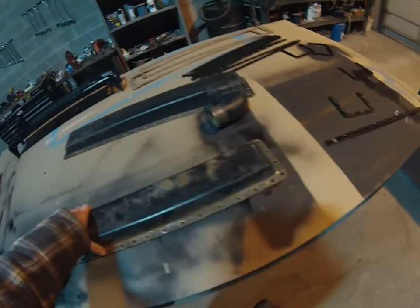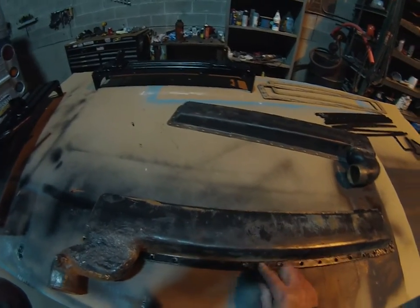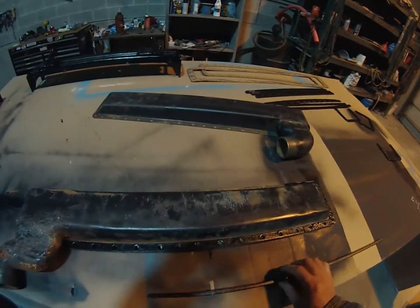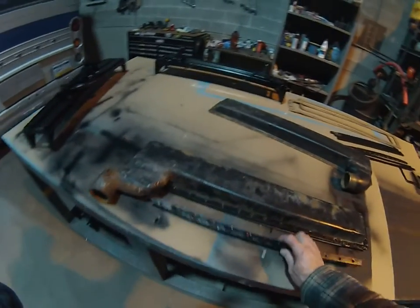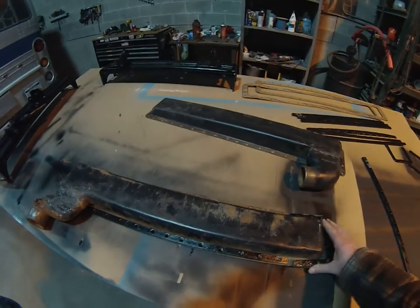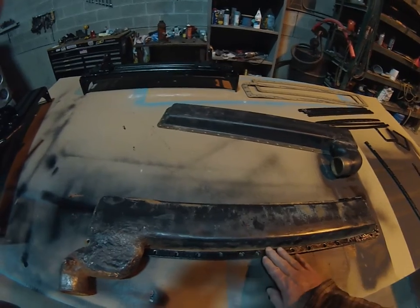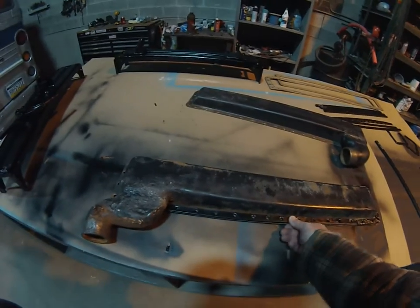So these just bolt on. These are the end plates that go on like that. These are the plates that go on like this. And then there are the thicker plates here. These are about 3/8. These are maybe 3/16. This goes underneath and sandwiches the flange of the core up under there. So I will actually put this together as I'm drilling. Drill a hole, put a bolt through, and work my way so I don't get any cumulative error. And I'll actually use this steel as a drill template, drill right through.